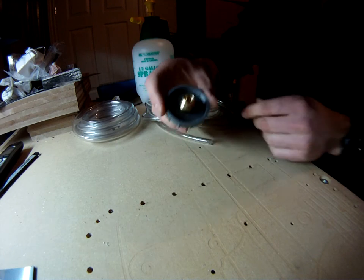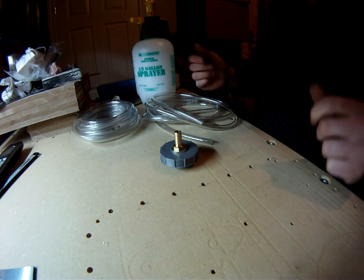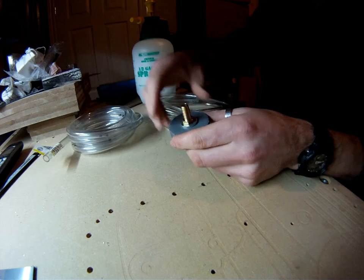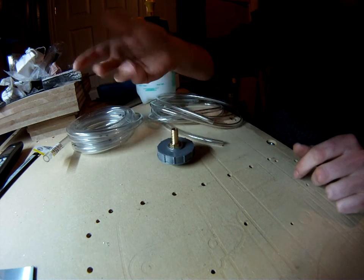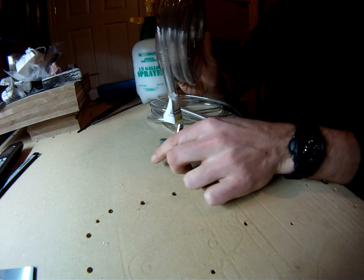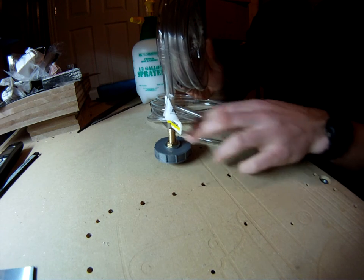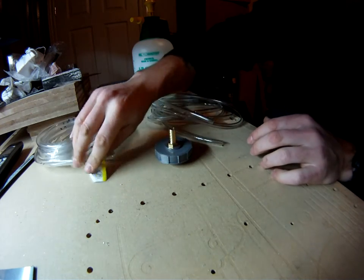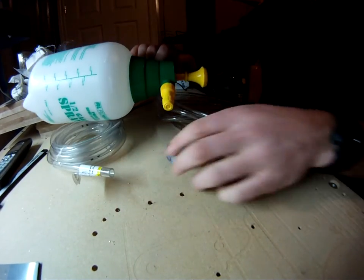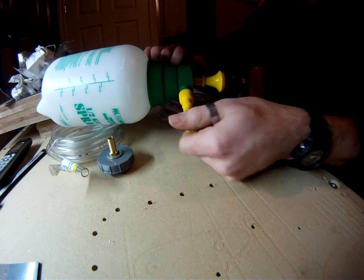So there you have it — that's the cap, and it's pretty much the hardest part. When you get this to your vehicle, take the old cap off and thread this one onto your master cylinder. From there, take your vinyl tubing, press it over the barbed end all the way down. You may want to install a small hose clamp to keep the vinyl tubing on there securely.